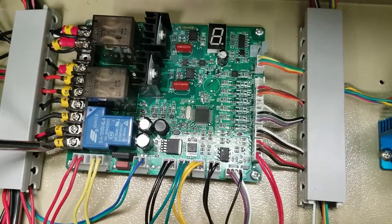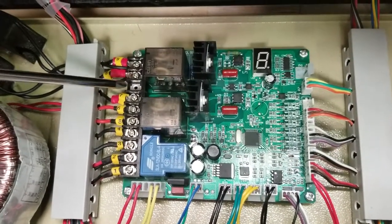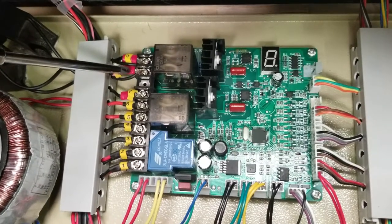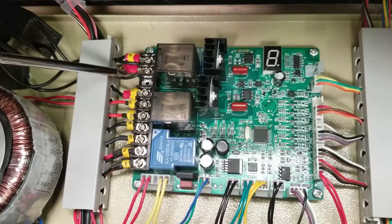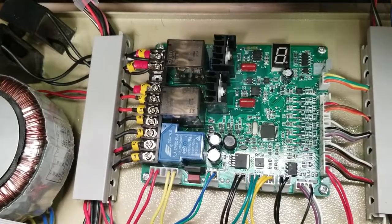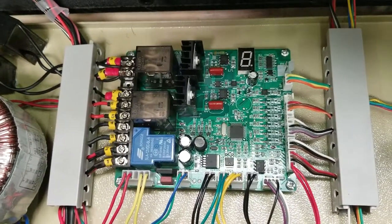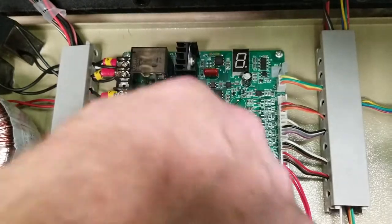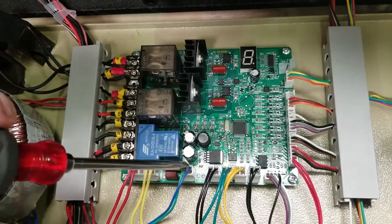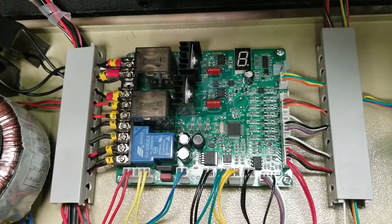Same with the front — the side is also numbered one through nine. This third from the top will be empty. On these last two, they'll be double wires. If they're not wired in the same plug, if they're separate, just make sure you get them both on there good and that one side is not touching the other. Make sure you get your screws down and check all your plugs again — make sure they're fully plugged in. Make sure none of the wires are backing out, because a wire could back out — you can see the middle post coming out of it. Make sure they're all in there good.